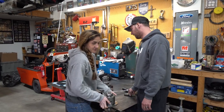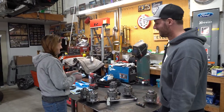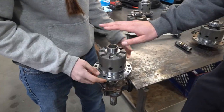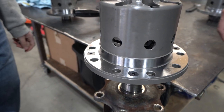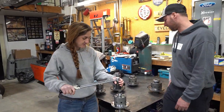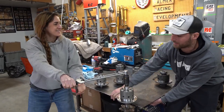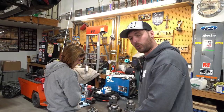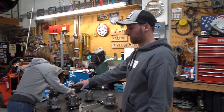Justin gets the new stuff. We're going to test Jake's — but this is not a super fair comparison because these are dry, straight out of the box and have never been run, so they don't have any oil in them. We'll just give you an idea of how tight they are. They're pretty rough — not even breaking away. They just maxed the torque wrench out. So we're going to pull Felipe's and Jake's apart tomorrow, soak the discs to get a fair comparison between the new ones and a set-up unit.